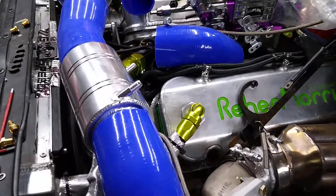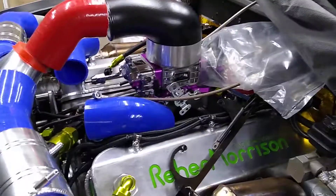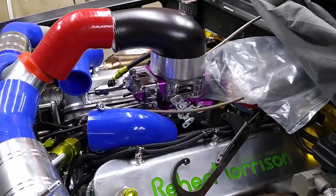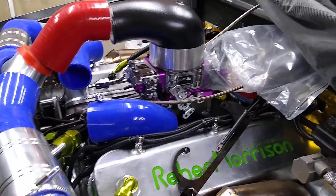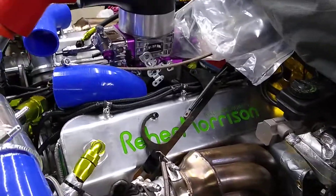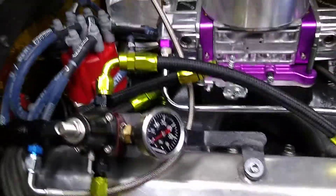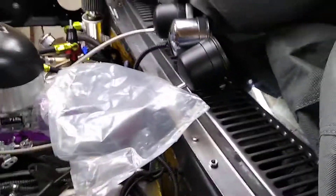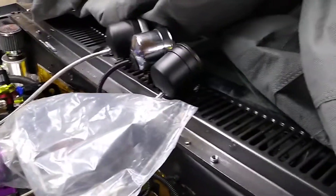This is all a learning curve. I've got another carburetor on there just to cover everything up and I need to get switched back, but that's about all we've got done. Everything else is plumbed in — all the lines pretty much run, all the fuel lines run into the regulator and out of the regulator, gauge is hooked in. Got the other gauge up here to measure fuel pressure at the carburetor. One's to measure at the pump, this one's for the carburetor so I can see it and watch everything while I'm in the truck.